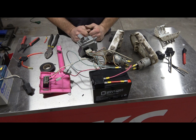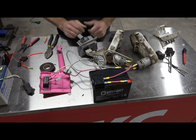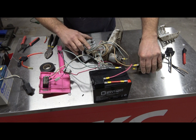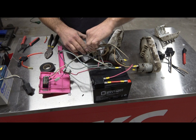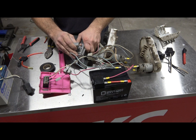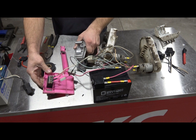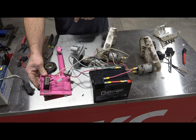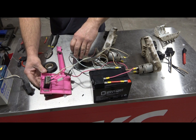Remember when I didn't label the motor leads — which one was from which battery? Yeah, I had a 50-50 shot. That's why I don't play the lottery. So anyway, if you didn't label them either, look at the shifter: there are two wires that come out of the middle that go to one motor, and then at the top there are two wires that go to the other motor. Also worth mentioning — if you're converting to one of these shifters you will no longer have high speed. Only one motor works when you put it all the way up. In the middle is forward and down is reverse — it's still the same speed, you're not losing anything.